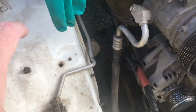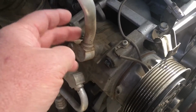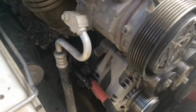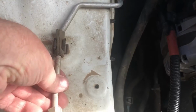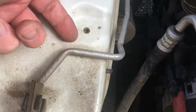All right, and then you just carefully put this back here in a situation where you're not twisting the hoses or damaging anything. Don't bend and break these pipes. They're really strong, but some cars you've got to be careful. General information again, we're trying to turn it from not just 1 kD into general information. If you're working with aircon pipes like these smaller ones, try not to bend them. There's a reason why they're bent carefully where they are. Make sure they're not rubbing as well on the body there.